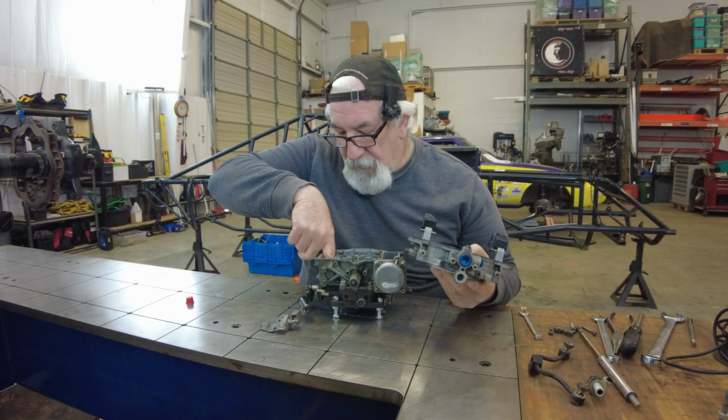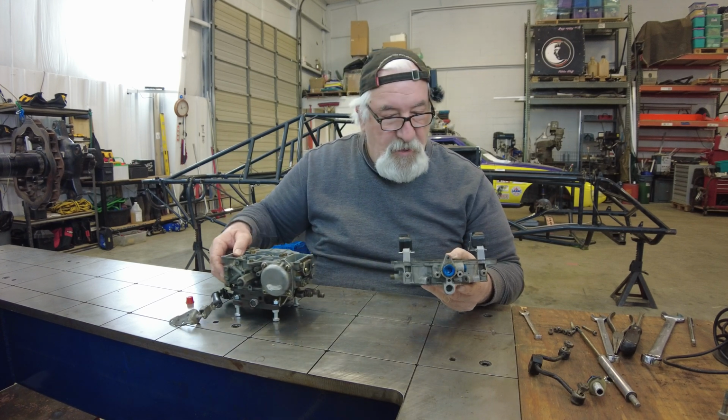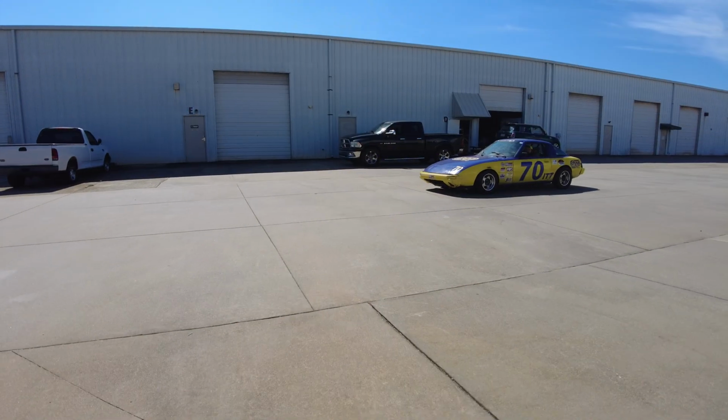And then we also completely rebuilt the carburetor. Yep, there's been some fuel left down in here and it's basically sludge now. And we did a full nut and bolt, checked everything, steering, suspension, motor mounts, the whole 9 yards. Adam's putting a little pressure in the tires, made sure that we got everything ready to go.